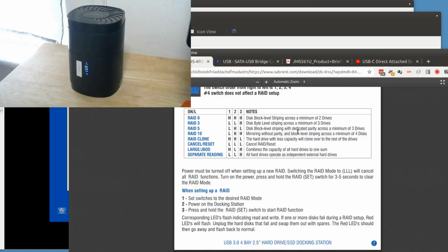Basically, it takes the data across some number of drives and does this magic XOR. I'm not a RAID expert, but I'm just saying it does this magic where if you're only missing one of the 4 disks, it can compute what was on that disk from the 3 other disks. In RAID 4, it's still true, but there's a disk only dedicated to parity, and the parity isn't striped across all the disks in the array. So this kind of freaked me out.